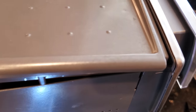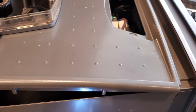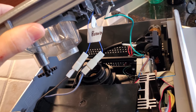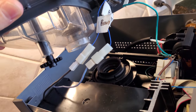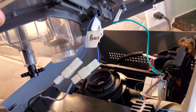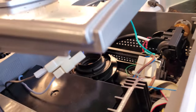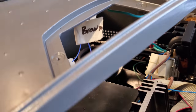Once you have all that out, pull towards the back and remove the lid. Be very gentle because it's attached with cables. You may want to label those cables — the blue and the brown — you can use a sharpie, I use tape with a sharpie. There is also an additional green cable attached there. For the time being we're just going to turn it so it's not in the way.